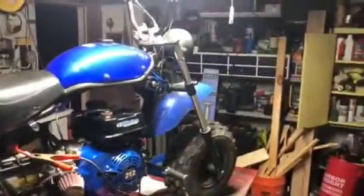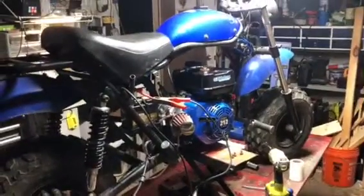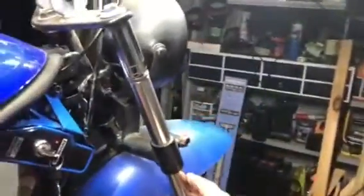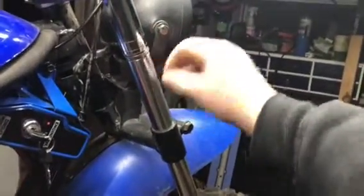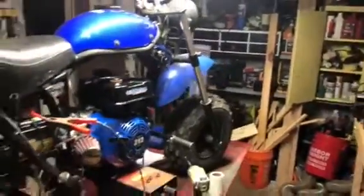The reason I raised the front end like that when I made these pieces is because when I put the rear shocks in, the front end sat lower and I just hated it — it just didn't look right, it was nose diving, always working against itself. I'm also going to split these open. If it's anything like a Harley, I'm just going to cut a piece of PVC — whatever spacers are in here, you can just cut a piece of PVC and hopefully it'll work. Maybe I'll make a video doing that too.